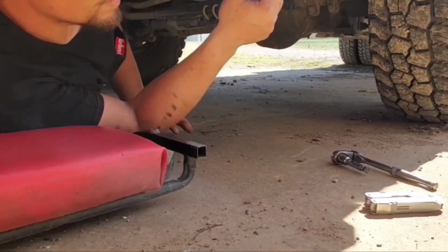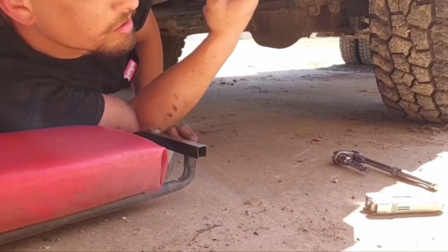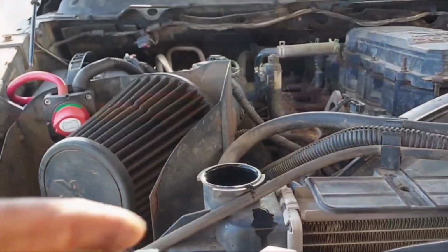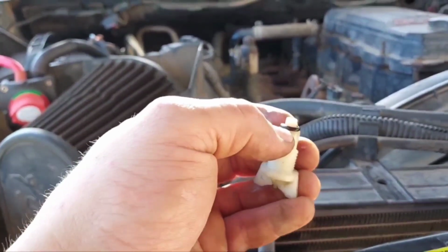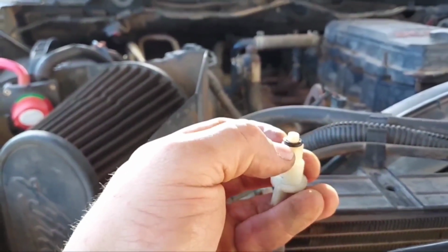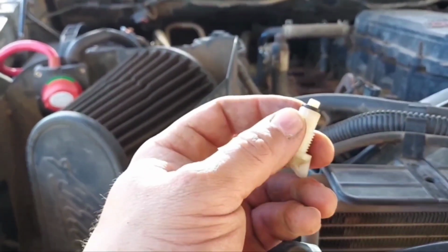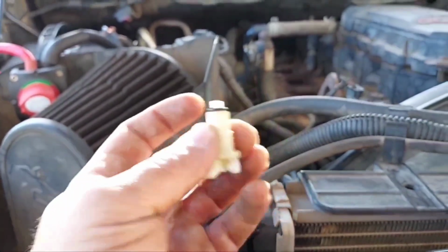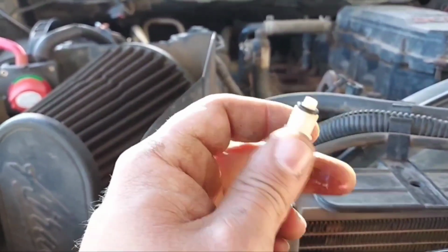Oh, yeah, I gotta safely and properly dispose of my used coolant somehow. I got an empty bucket around here somewhere. I'll find it. Alright, so while that's draining down into a bucket, I'll just go on ahead and point this out. People always say don't ever pull the drain cock all the way out of the radiator, and the reason why they say that is that little O-ring right there tends to stay in the radiator, or lets you get the drain cock out of the way, and then it flies out and you lose it somewhat forever. Well, some people lose it forever, but anyways, you just be real gentle pulling your drain out and you got no troubles.